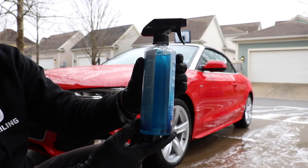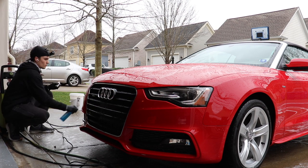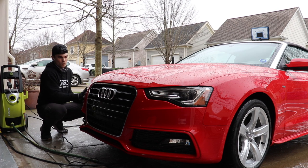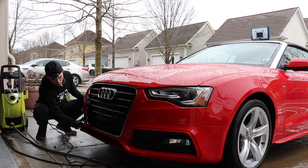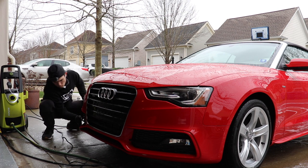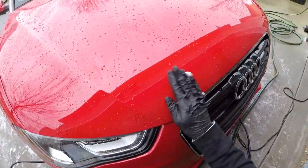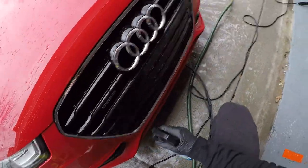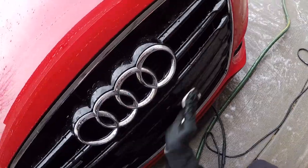You can see from the different shots the hydrophobic properties of that NL272 coating. This is the Last Coat's product called Amp, and this is a product that I'm using basically as a clay lubricant. The reason why I'm using it as a clay lubricant is the Last Coat products — this video is not sponsored by them — are designed to be used on vehicles that have a traditional ceramic coating on top. So I'm not going to be actually clay barring the entire vehicle. There are just specific areas of the vehicle that need to be clayed before we end up topping that ceramic with another ceramic-based spray protection.